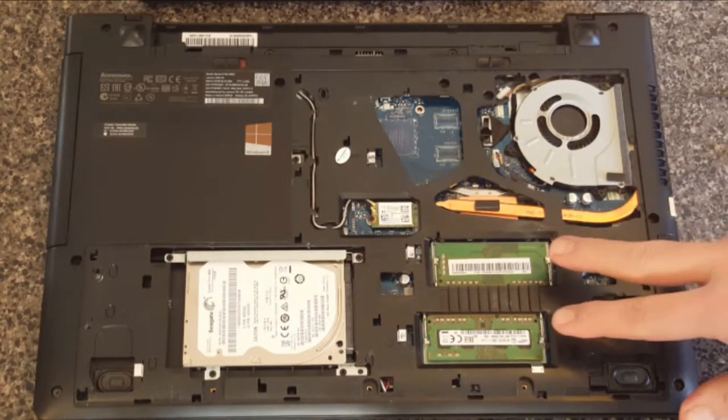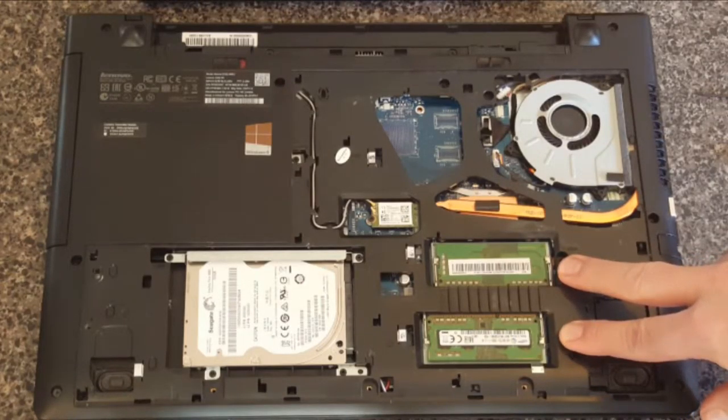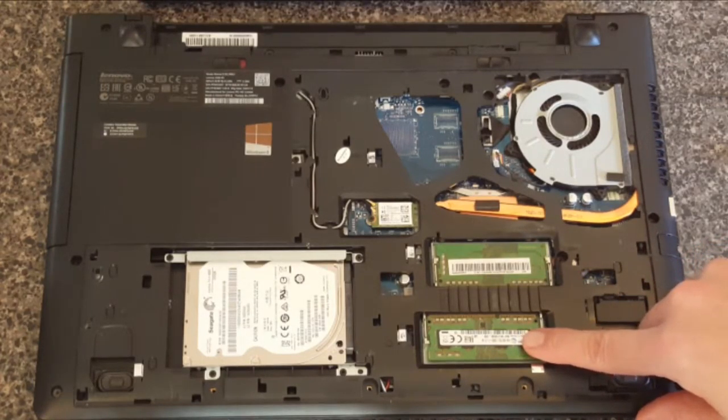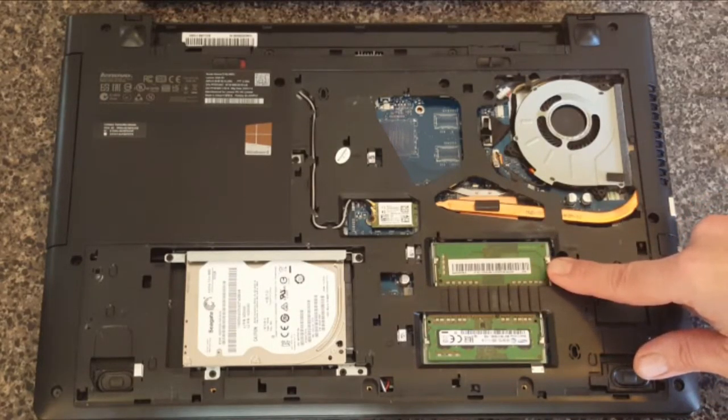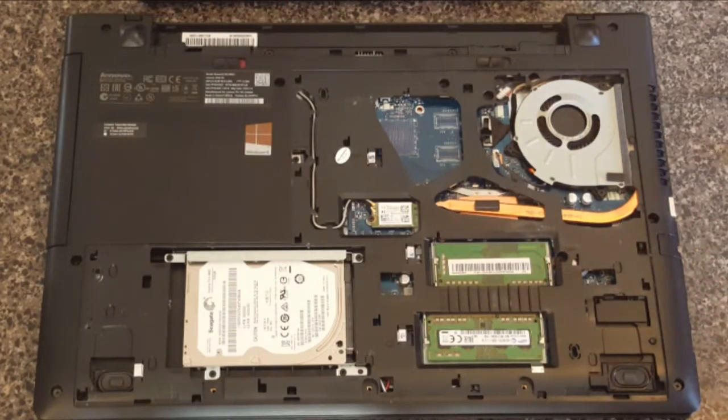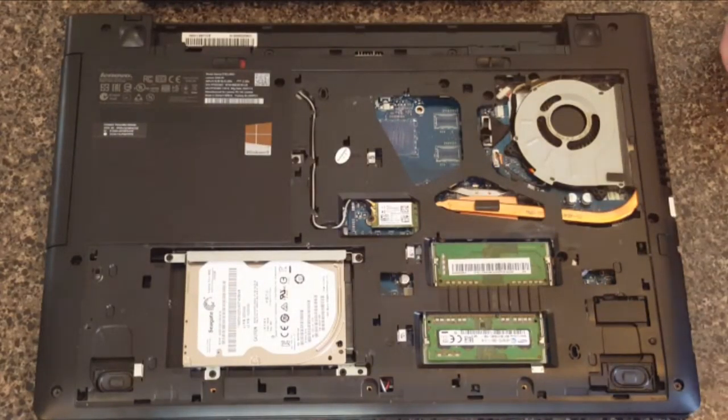When we want to replace the RAM, the laptop comes with two chips. One has two gigabytes and one has four gigabytes. The label on the back of one says four gig, so I'll fairly safely assume the other is our two gig. What I'm going to do is take out the two gigabyte chip and put in an eight gigabyte one — essentially doubling the RAM. You can go all the way up to 16 gigabytes, but I decided to just throw one in at 8GB and see if that does what it needs to do. At 30 bucks a pop, it's not a huge deal.